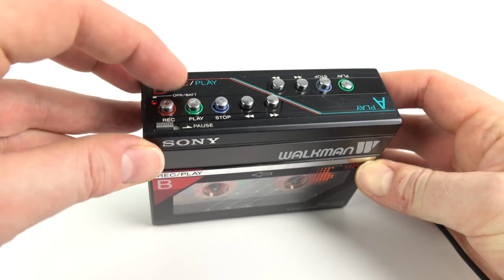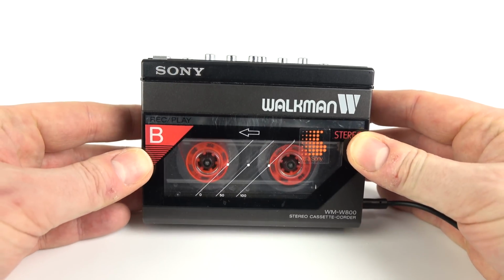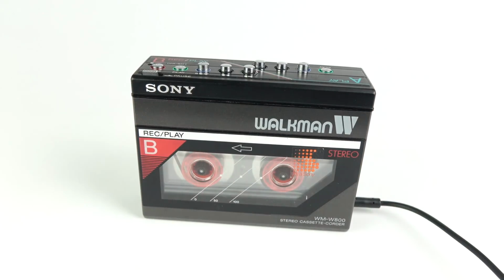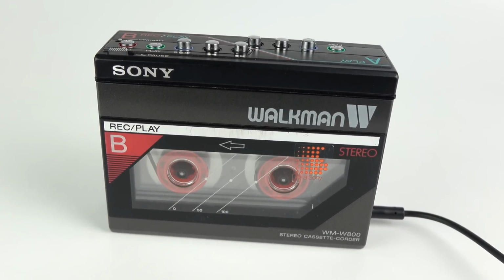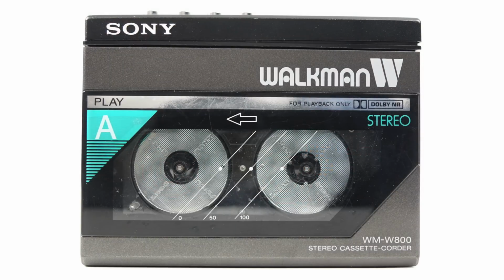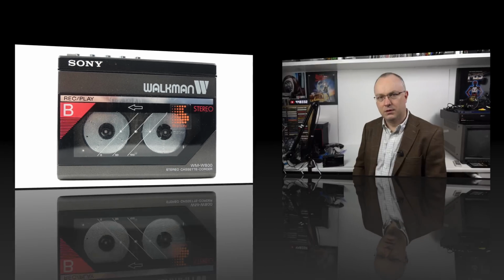I did try dubbing a tape from deck A to deck B, the thing that I'd mentioned right at the beginning of the tape as being the feature that appealed to me back in 1985 as a way to copy Spectrum games. I've got a good feeling that the duplicated tape would not have loaded because it did sound pretty wobbly. I think this thing needs new pinch rollers and perhaps a complete overhaul, but I think I've also spent more than enough time on this particular deck already.